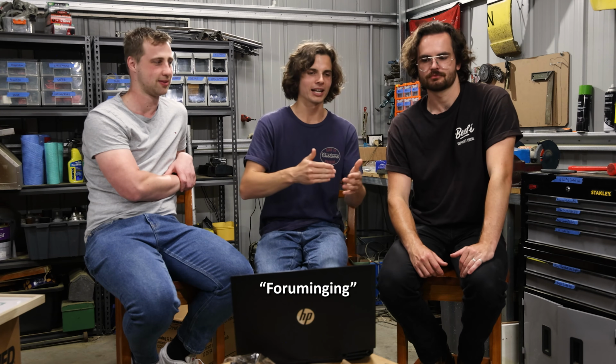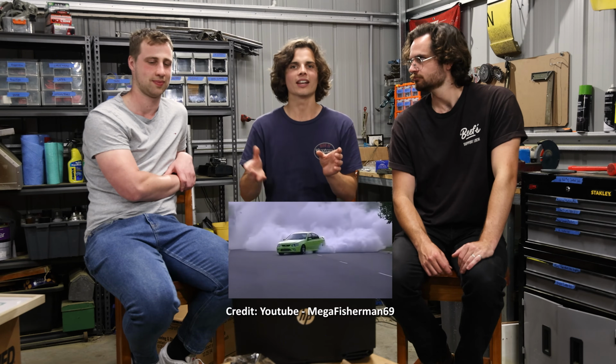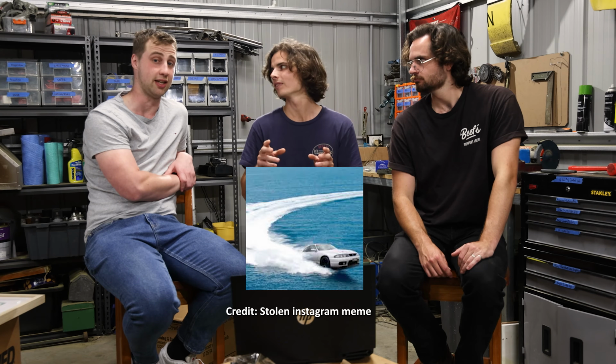What we found through foruming was some random guy who said, hey, I think he had an MA60 Celica or something. He's like, if you grab ST141 struts and stub axles, you can run BA Falcon rotors re-drilled to 4x114 with R33 GTR, the sort of POV spec GTR, GTS. Any turbo R32 or R33 with Sumitomo calipers, or turbo S chassis, even the 350Zs, maybe? Basically, the cheaper performance brake option that Nissan had in the 90s were Sumitomo 4-pot. Anyway, Sumitomo. I think it's Sumitomo 4-pot calipers, the solid ones.